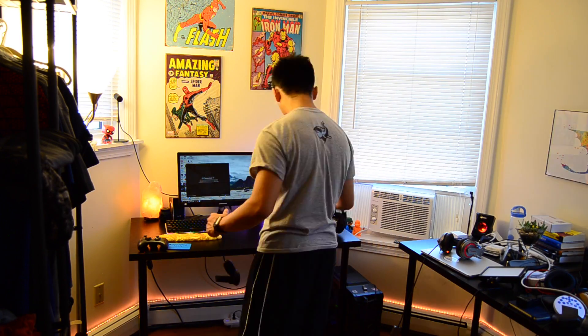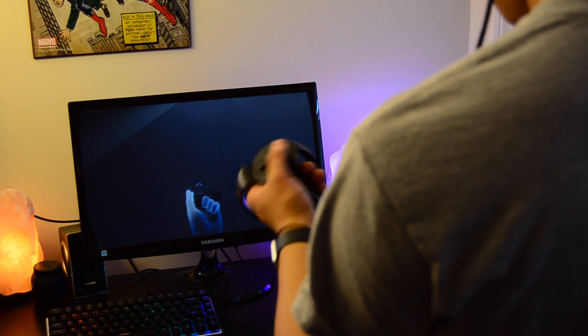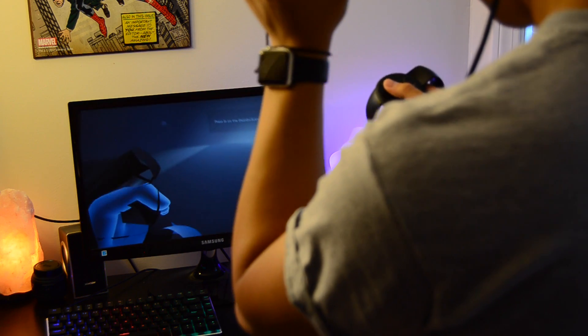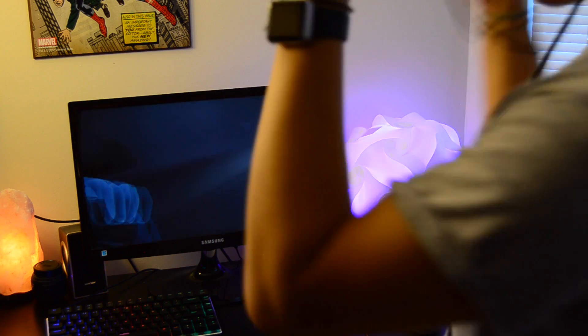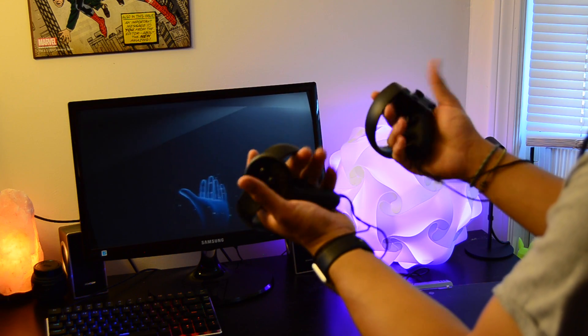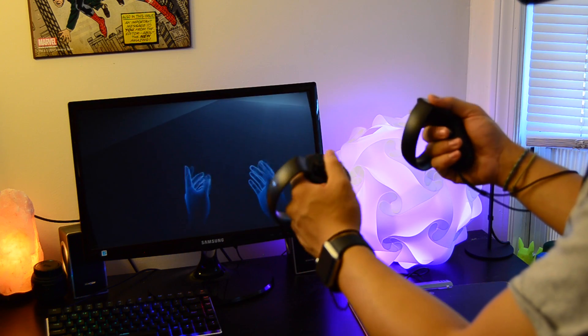Now I want to talk about the setup process. With the Oculus Rift it seems pretty robust. Basically, you plug in the two sensors through USB — 3.0 or 2.0 — and then plug in the headset through both HDMI and USB. Make sure you plug the headset directly into the graphics card, and also that you have a graphics card with either dual HDMI out or a DisplayPort out for your monitor. I think the setup process is very similar to setting up a Wii — it's just a regular console. There are a few annoying things with setting up the sensors, but if you're interested in computers or virtual reality at all, you're probably going to be well-equipped enough to handle it.